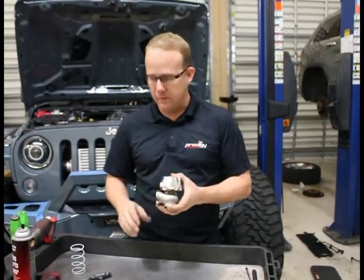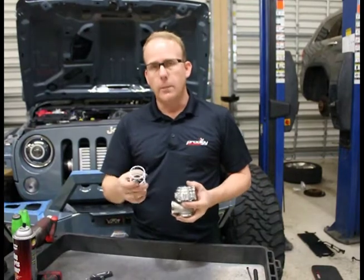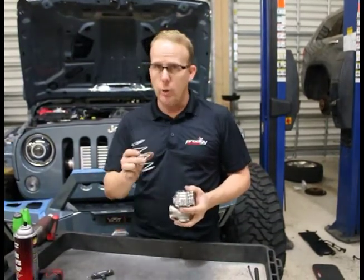Here's a step in our system, either upgrading from a stage 1 to a stage 2, or just about the wastegate itself. Here's a Tial wastegate that's included in our Project Performance Turbo systems. Our stage 1 comes with a red spring, our stage 2 comes with a white spring. Here's an example of the white spring. What I'm going to do in this video is show you how to remove the red spring and change it to the white spring.